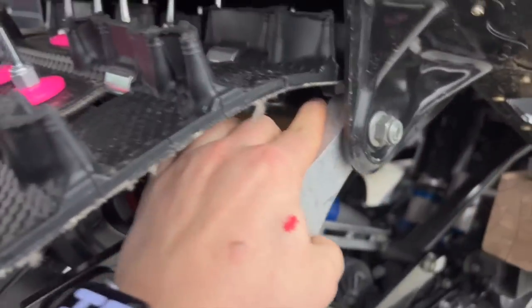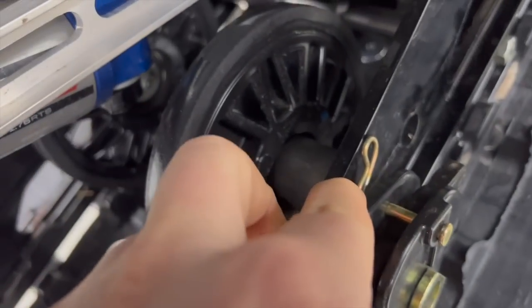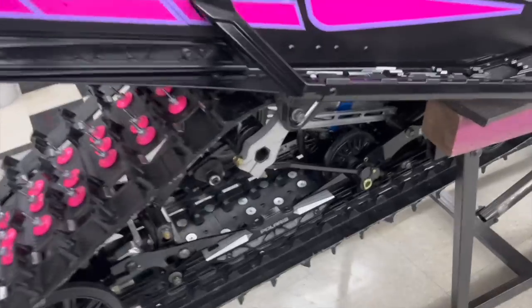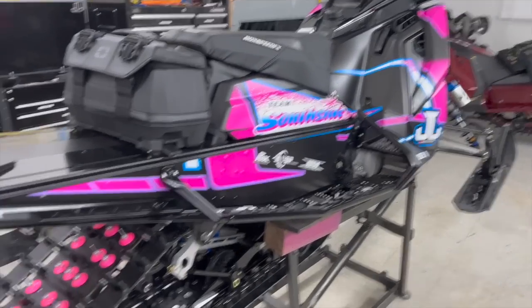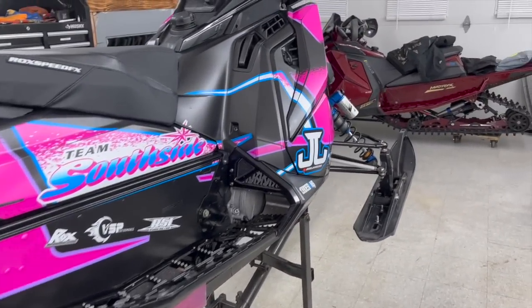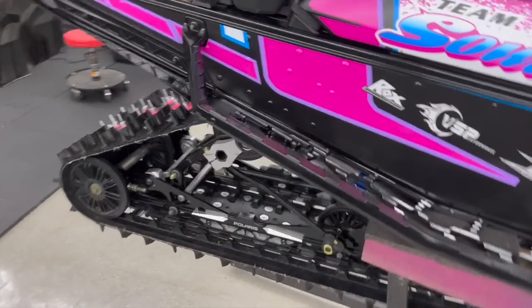You need two 15-millimeter wrenches for this, and you need two 13-millimeter wrenches for these. And then this pin right here, you pull that safety pin out, pull that pin, and it's just going to lift right out of there and right around. I have this stand, so I lower it down just to take a little bit of pressure off, and all those bolts will come right out. It's a very easy process, but I'm going to put them in and go ride it just the way that it is now, and then go from there. Next video we'll be replacing different shocks with different valving in it, different front springs, and most likely different valved front shocks. But again, this one we're just doing heavy duty torsion springs.